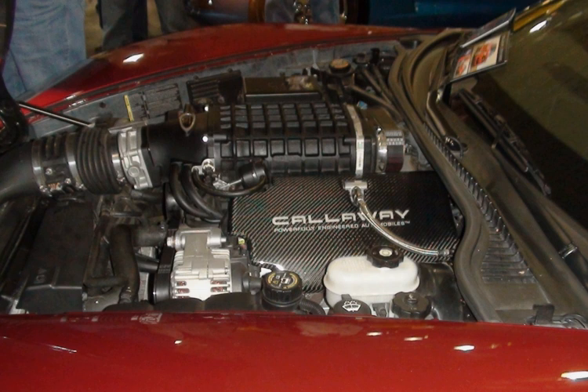This family of Generation IV 4.00-in bore blocks were the first of the Generation IV small block, with the LS2 being the progenitor of this family and generation. This family has seen a wide range of applications from performance vehicles to truck usage. The Generation IV 6000 is a V8 engine displacing 5,967 cc from a bore and stroke of 101.6 mm × 92 mm (4.00 in × 3.62 in). It features either a cast iron or aluminum engine block with cast aluminum heads. Certain versions feature variable cam phasing, active fuel management, and flex fuel capability.